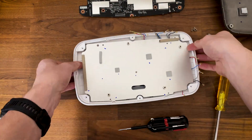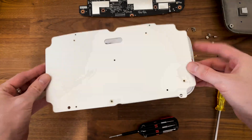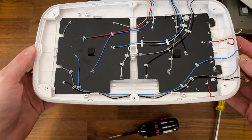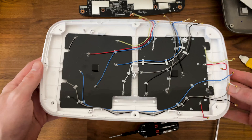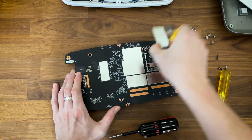I took out four of the screws, but there is one in the middle as well, so don't forget about it as I did. Then the heat spreader can be removed, and we can see the intricate antenna design. I do need to mention that Zyxel does advertise a smart antenna approach, which should significantly help with interference.